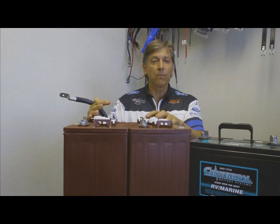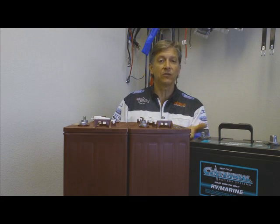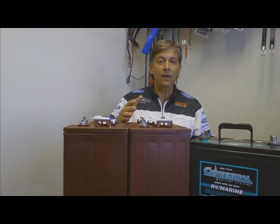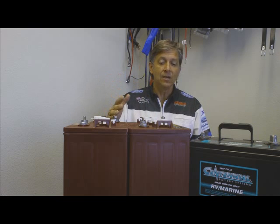The reason why the 6 volt battery is better for dry camping is three reasons. One, it's got more amp hours — more electrons, more capacity. Two, you can take it deeper in discharge before you have to recharge it. And three, these batteries have about three times the discharge-recharge cycle — they call it life cycle. So you get three times the life cycle, you can take it deeper in discharge, and they have more amp hours.